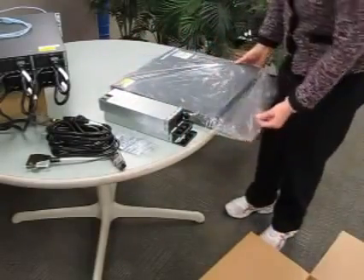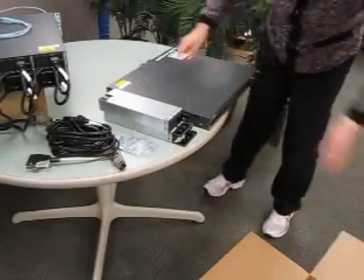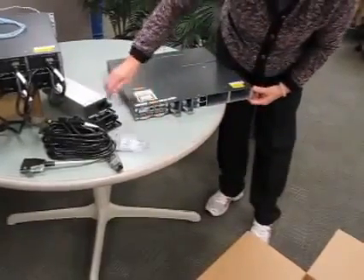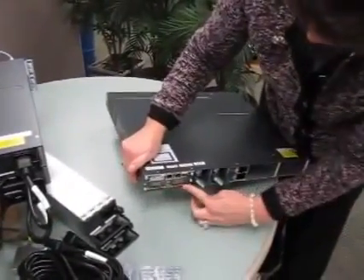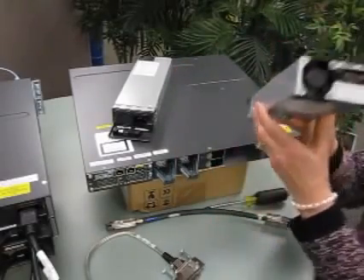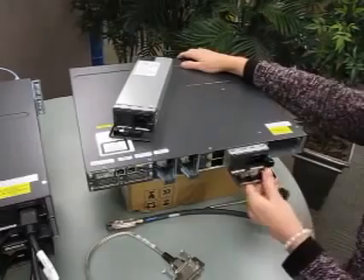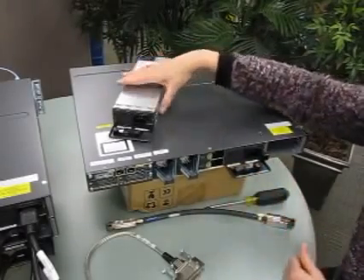This is the bottom switch, so we'll start with this one. Turn that away from you so you can see all the open slots. Right now there are two silver covers covering the stack mount interfaces — we're going to take those off. You can see the open interfaces there. These are the open interfaces for the two power stack cables, and these are going to be the two slots for the new power supplies. The power supplies are slotted with a connector in the back, so when you snap them in, you'll feel a snap. Pick any of these slots — the power supplies are the same. You slide them in and you can hear the snap in place. To remove one, there's a release key on the side — you press that and pull it back towards yourself.